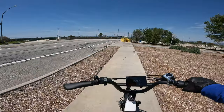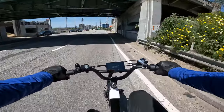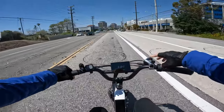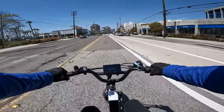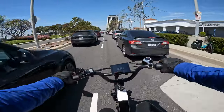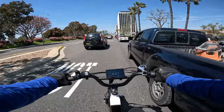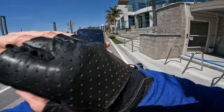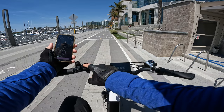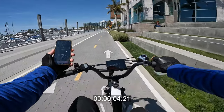It's a pretty decent rear suspension. So let's get out on the road and see how fast we can get this up to. Theoretically you can pedal up to 28, but my legs are moving really fast — the seven gears on the shifter are tailored more for speeds up to about 25 miles an hour of pedaling. The list weight of this bike is 77 pounds or 35 kilograms, significantly less than the pro version with two batteries and two motors. Let's see how the light version does on the zero to 20 acceleration test. I weigh 200 pounds, sport mode, top pedal assist, throttle only. Much more gentle launch for sure, but brings us up to speed decently quickly.